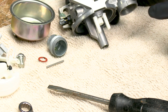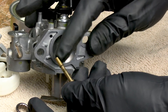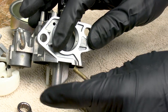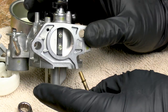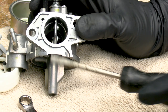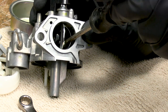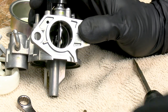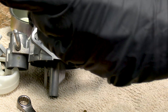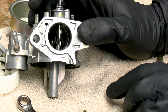One other thing I wanted to show you: the emulsion tube. It sticks through on the smaller end right here — you have a larger end and then a smaller end. That smaller end, when it's sticking through, will stick through in the middle. If yours doesn't fall out, you'll see a little brass thing sticking up here in the middle, and you can take a screwdriver or something like that and push that down to encourage it to go.